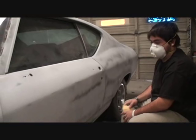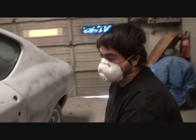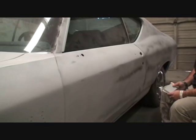Now, when you're in the dead cold of winter and it's freezing cold, dry sanding would be the way to go because the wet sanding is what? It's too cold. It's too cold, and you might as well be up in the Antarctic swimming around in the snow when wet sanding. So now that the weather has turned on us for the better and it's warmer out, we're going to go ahead and block sand at once with 180. And then we'll finish it out with what?